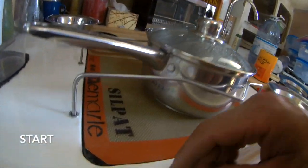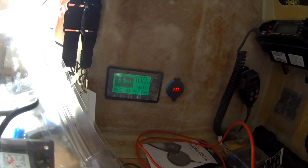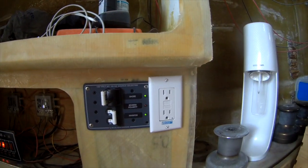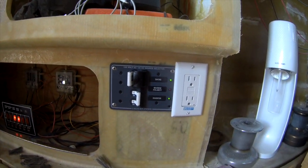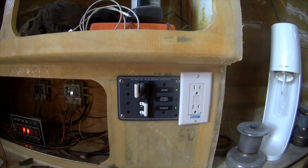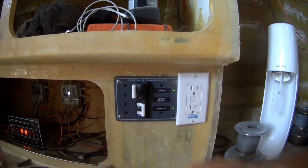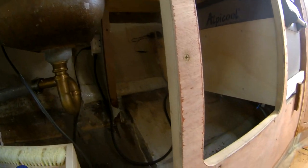Right now we're boiling some water — running at 5, so half load. According to my battery monitor, we're drawing a kilowatt — 1000 watts — to run that thing. I measured 900-something watts to boil water. I had to replace the single shore power with a selector — it's got this slider blocker mechanical thing so you can't turn them both on at the same time. I have shore power off and I'm running on the inverter — those outlets are running on that.